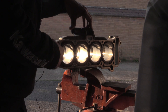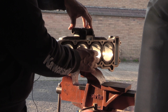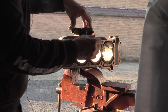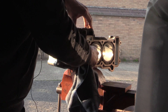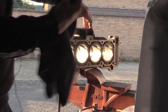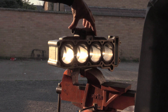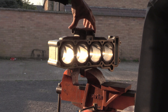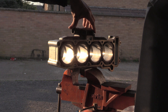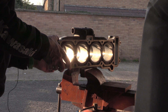For a bore like this with no ports, if you've got them brushes and you just give it a quick go just to clean this carbon buildup off, that's fine — you're not really going to cut into the material. And people say stuff like you can't rub carbon off into the bore. For goodness' sake — number one it's Nikasil, number two this has just done 91,000 miles with metal parts rubbing against it, flames and fuel and all sorts, and she's looking pretty good. With Nikasil coatings done correctly, they can come out pretty good.